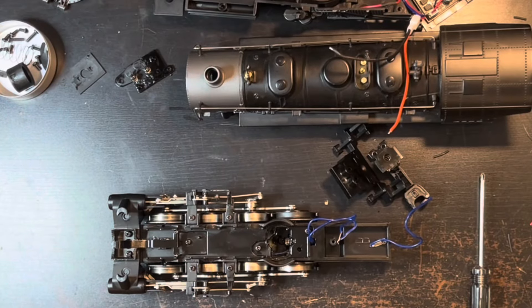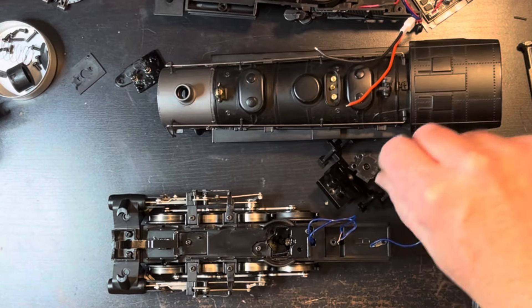There are a couple more screws and maybe a few more steps, but getting it apart to clean and service it isn't that much more complicated than an older engine. The same idea applies — look for the screws that would make sense, take them out, and if you don't want to take them all the way out, unscrew them about halfway and see if you've got play. Just take your time, be patient, and if you need to, take some pictures along the way so that you have something to reference when you're putting it back together. I probably should have taken a couple more pictures.